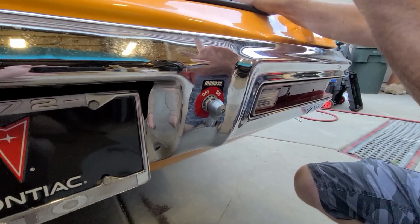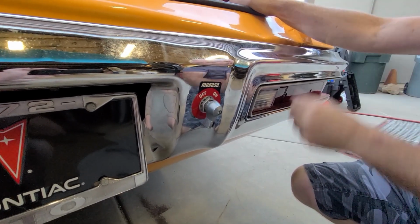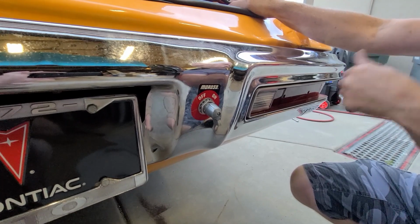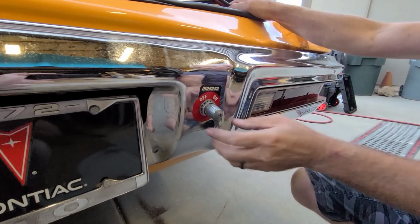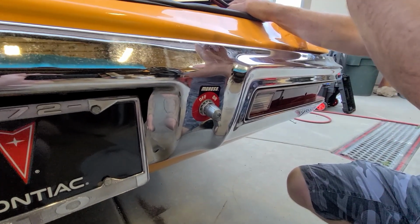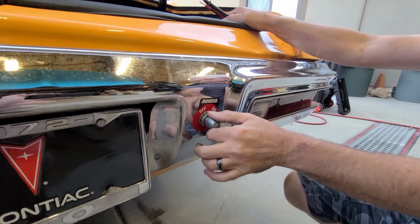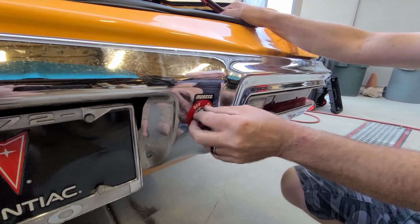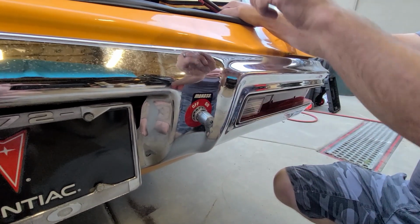Something else you should do is you should test it again. Bring the RPMs up a little bit to excite the field on the alternator, so 1200 to 1500 RPM, and then have someone shut the switch off. Make sure your fan is on, your water pump and all that stuff too, because you want to make sure that at RPM, with the alternator excited, the field excited, and the fan running, your engine, everything shuts off.